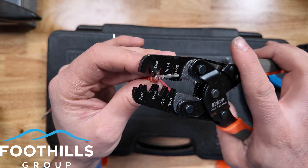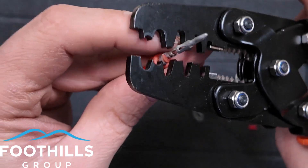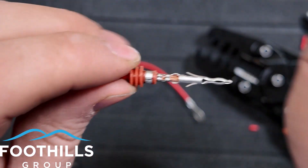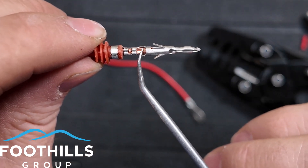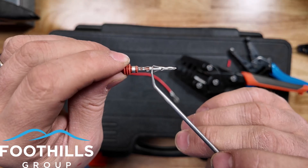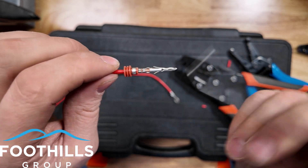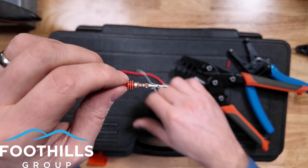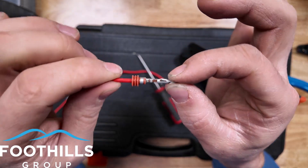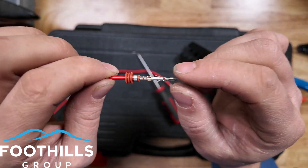Now we do the electrical connector — still 14, 16 gauge. Flip around, roll those fingers in, and go one size down to make sure it's got a good bite. Keep in mind when working on weather pack pins that you don't want to push in or crush this little tab, and you don't want to crush these fingers, because the plastic body of your connector sits between these two places. If you crush either, the pin will move around more. You want to make sure that when making connections from plug to receptacle, the pins and sockets don't move away from each other. That's how you build this open barrel style crimp — crimping properly on the conductor with no stray wires, so it fits properly into the plug.